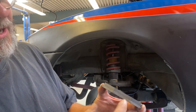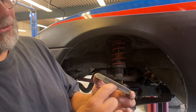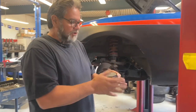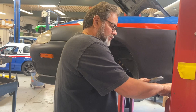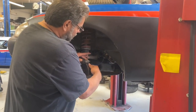This little thick part right here is actually the brake lining - this is the part that actually wears out. This is the metal backing plate. What we don't want to do is run the brake lining so thin that the metal starts to touch the rotor - we call that metal to metal. This is a Raybestos racing pad - they're great pads. I use Hawk Blues, but my buddy likes the Raybestos pads, and that's okay because I beat him on the racetrack anyway.